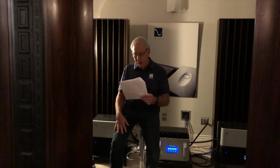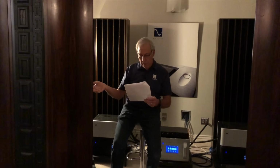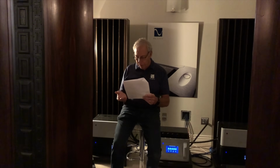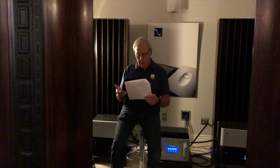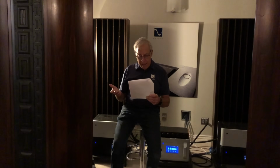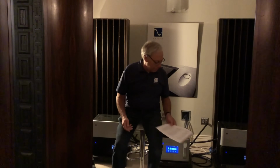He writes, hey, you talked about voicing, for example, the BHK power amps on this system, but how does the IRS crossover actually work? The subs have their separate amplifiers with servo controllers. Does the preamp feed the crossovers and the output of them feed the BHK amps to drive the mid-range tweeter cabinet? If it's like that, does your power amp match the gain of the sub amps, or do the sub amps have adjustable gain? If the subs have separate gain control, how do you know the bass cabinet is not overpowering the mid and hi-fi cabinets? Well,